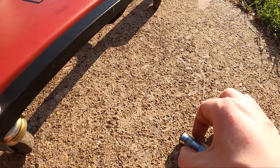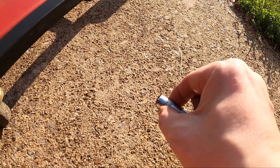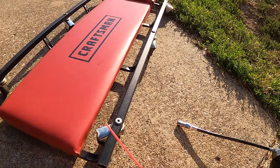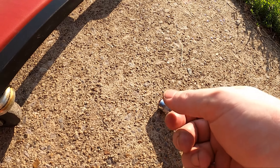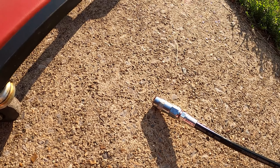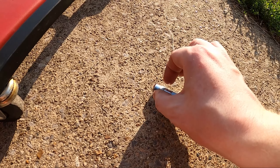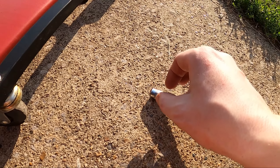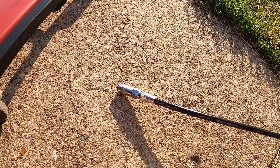I'm all done. It took me probably about 15 to 20 minutes. One thing to note: on this fitting you can spin it — if you spin it to the right it'll loosen it, and if you turn it to the left it'll tighten it. You want to loosen it, pop it on, and then tighten it down if you can — that'll prevent the grease from squirting out. Don't have it super tight because if your gloves or hands are greasy you're not going to be able to grip it, which happened to me on the last fitting.